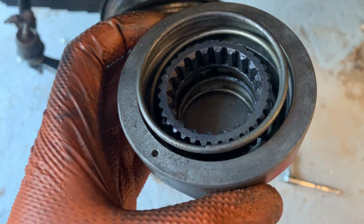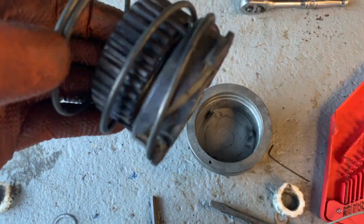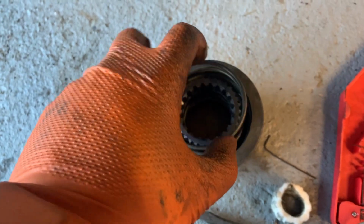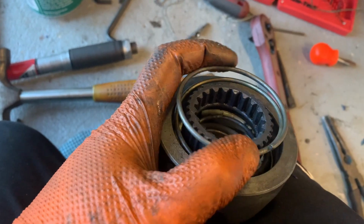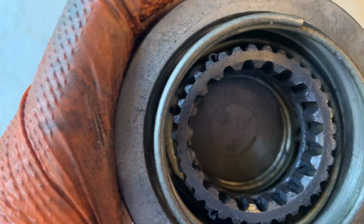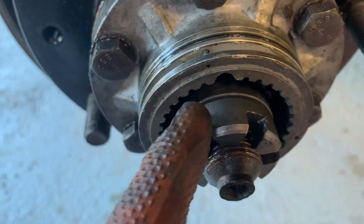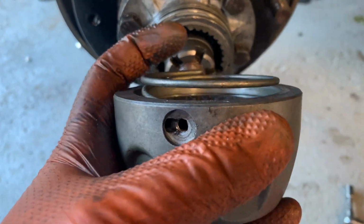So you put the plastic end of the slidey bit, this whole assembly here, smear it all with grease, all over those cam covers, or the cam sort of sticky out bits, and pop that in there and give it a little bit of a rotation so that it sits down within the cover. Easier said than done. There we go. Right, it's in. So there's 3 master splines, so those ones, the little roll pins, 1, 2, 3. They're going to line up with the slightly larger holes here, and then you pop that on, and then it's ready to slide the little plastic retaining strip here.